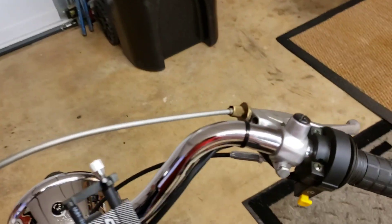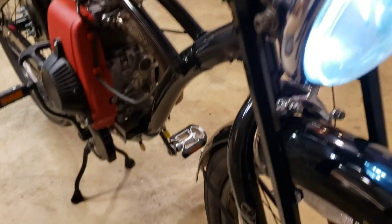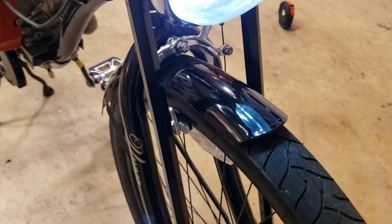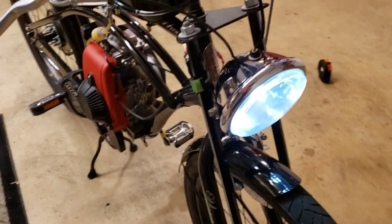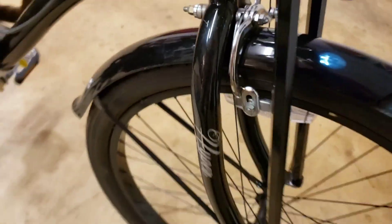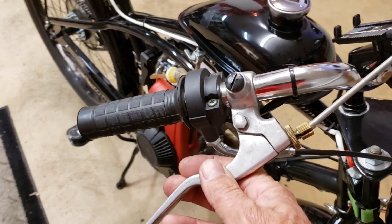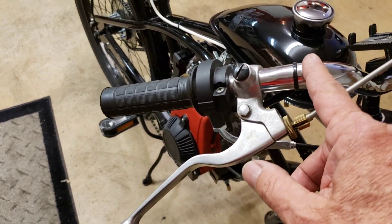There's the front brake I replaced first thing when I got the bike. I had one of these caliper brakes — typical bicycle brake. There was a hole there to hold the fender, so it mounted right up. I brought it up, cut the cable, and used a motorcycle brake lever — fit right on here perfectly.